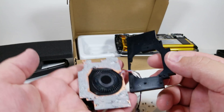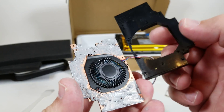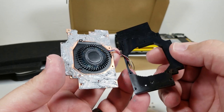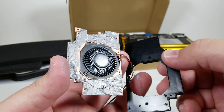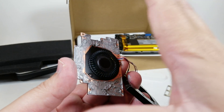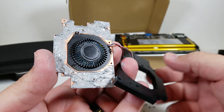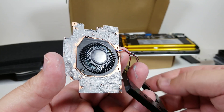Here's the point where no matter how you do it, it's going to get messy. So what you're going to want to do is you're going to want to apply enough thermal interface material that it spreads out evenly, and when you sandwich this together and screw it all together it makes a nice bond. There will be some seepage and there will be some cleanup. So I'm going to go ahead and do that now and also clean it up.